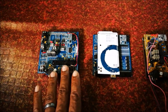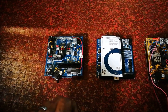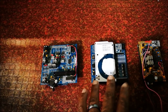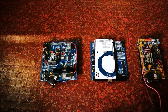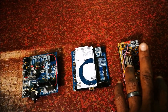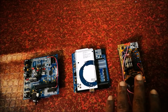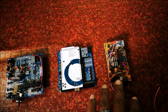Starting with the v0.4 overview: this one does four channels, so we can run a four-cylinder engine in sequential mode, or six cylinders in batch, or eight cylinders in batch. The UA4C is pretty much identical — same four channels, four cylinders sequential, up to eight cylinders in batch. The NO2C, on the other hand, has two channels for fuel and two channels for spark, so we can do four cylinders in wasted spark and four cylinders in batch fire.